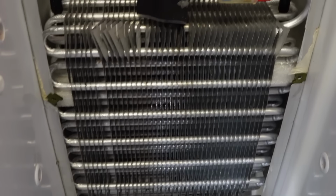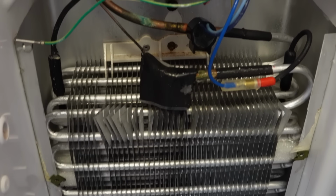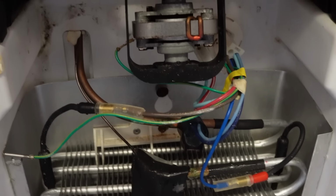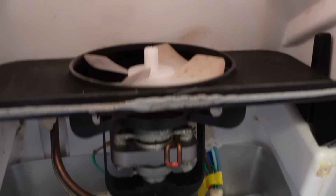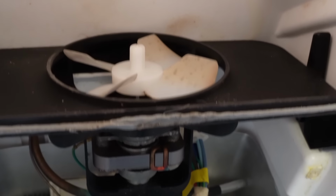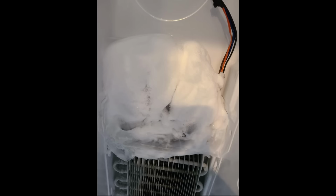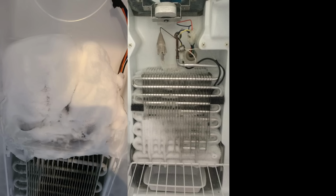On this evaporator system, a major thing to note is that we see no frost or ice buildup on this particular system. Generally, some frost is acceptable because the extremely cold temperature and nature of the refrigerator will allow moisture to get on the evaporator piping, which will cause the moisture to freeze on these coils. Now, if instead you see a huge chunk of ice, something with the defrost system has gone bad and needs replaced.